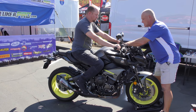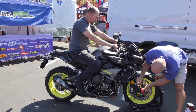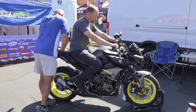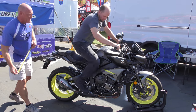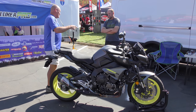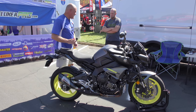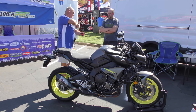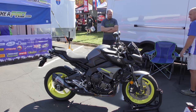All right, take a seat. Okay, so you're nicely balanced and you can feel the pogo in it. So 35 mil in the front — there's your pogo. All right, go ahead, dismount. 20. So the sag's correct. You're 30 in the back and 35 in the front, so it's just nudged ever so slightly forward. You've got just enough static in the back, so the issue is all hydraulic. As it unloads there's no control, front and rear. You're having way too much hand duress through corners and straight line is just miserable.